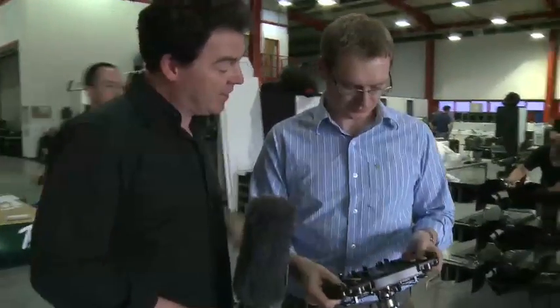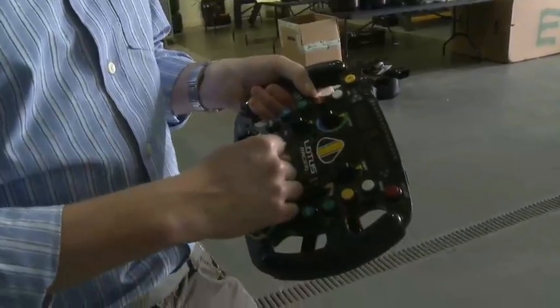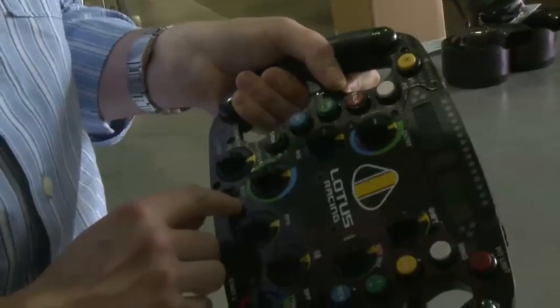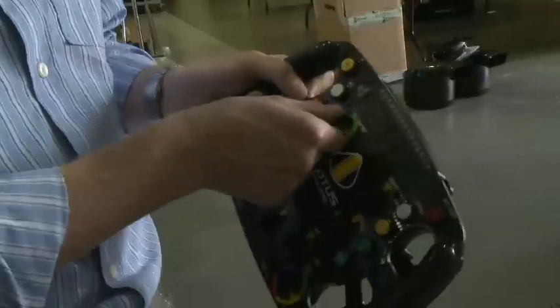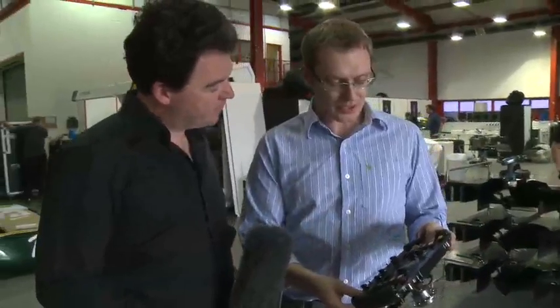Let's take us through. These left ones here — the rotary dials on the front are for various map positions so the driver can adjust the behaviour of the car. These three on the left are for the differential at the rear of the car so that you can adjust the balance of the car through the corners. We break that up into corner entry, middle of the corner and corner exit. We've colour coded the dials for wet and dry settings. If the driver has a bit of understeer going into the corner, he would adjust the entry dial, and on exit he can adjust that too. He will probably play with it a few times during a session — perhaps as the tyres go off he may wish to adjust the balance of the car, or if there's been an aero change at a pit stop.